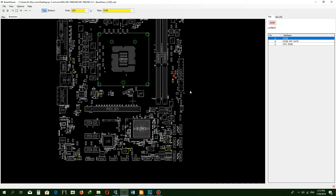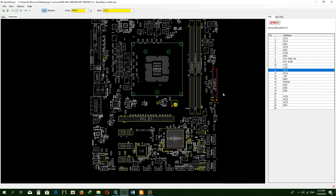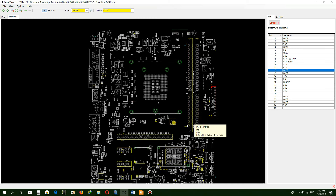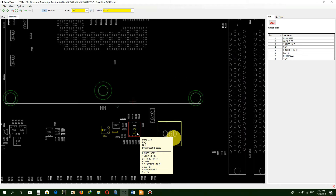In the next step I check the switch voltages. The first switch voltage to check is plus 3V switch, which enters different blocks such as PCH, IO, PCI slots, PCI Express, and RAM slot. 1.8V CPU is provided by plus 3V switch, generated by a MOSFET and an op-amp.